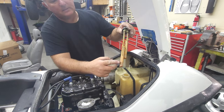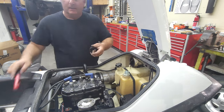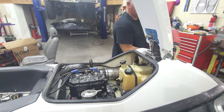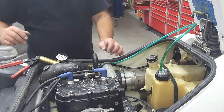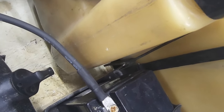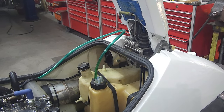We're going to put this down in the tank and put a Sharpie mark on the outside of the fuel tank where it ends up. All we're going to do is pull vacuum on this — the fuel stops right about there, holding vacuum. We'll redraw the line so that when we're ever on the water and having fuel trouble, we can look at the Sharpie line. If it's below the line, we're out of gas. This is our reserve strainer — it goes deeper in the tank.